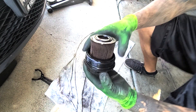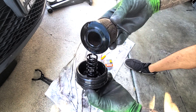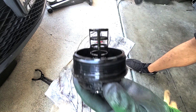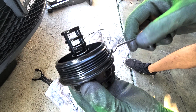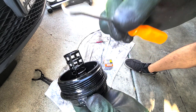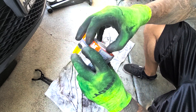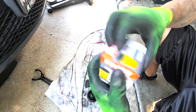On this filter, what you're going to do is take out the cartridge — that's the one you bought from the store that you're going to replace. And what you don't want to forget: there's an O-ring here. You want to get your little hook — you can get them at Harbor Freight, two bucks a pack. These little picks are lifesavers. If you work on motors and do oil changes, you need picks. So you're going to replace this gasket. Open up the new box. The filter we're going to be using is 9641 — TG just means Tough Guard, but most of the filter numbers are 9641 for this vehicle.